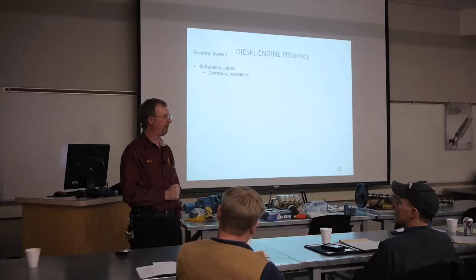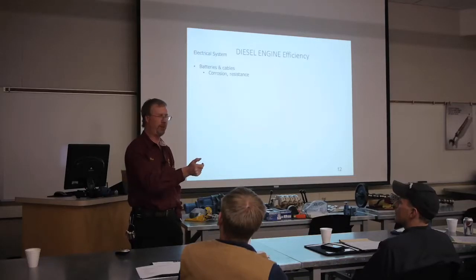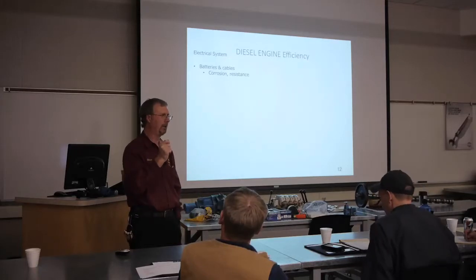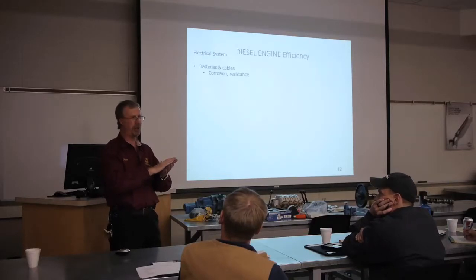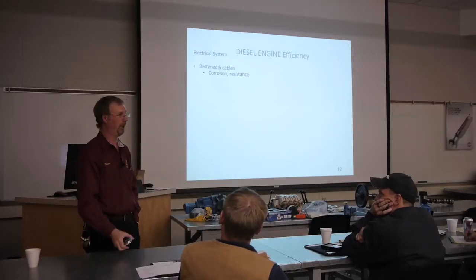If I think I've got a parasitic drain, I just start pulling one fuse at a time, all right? If the amperage stays the same, well, apparently that circuit's okay. Put it back in. Take out the next one. I pull out one fuse, finally, and that amperage goes way down. Aha, that's where the problem is. And in that particular circuit, it might be that I have corrosion, might be a bare wire that's just touching on the frame. It could be a myriad of different things, all right? So that's something that your producers can check pretty easily, all right?